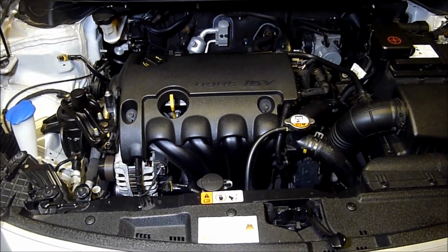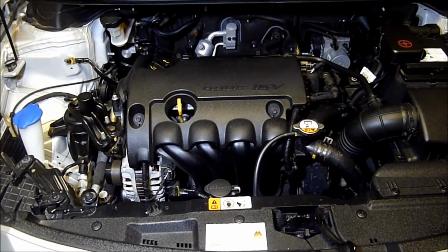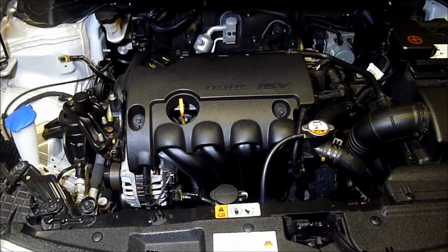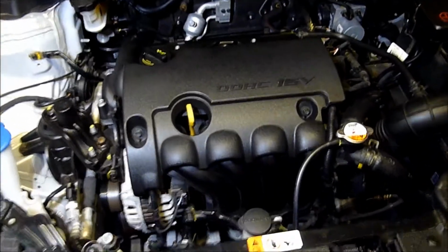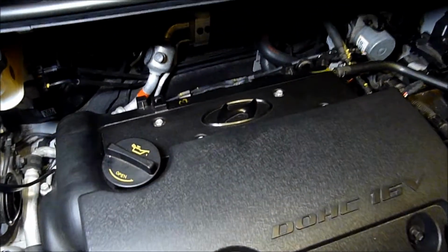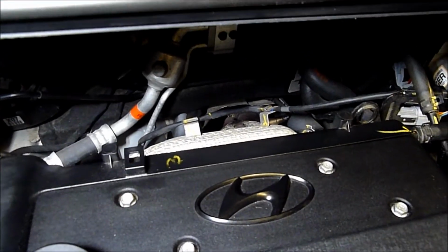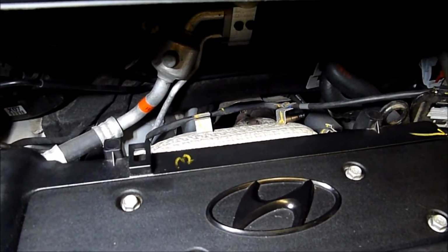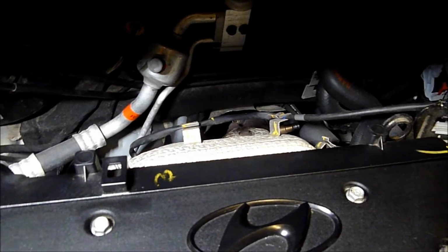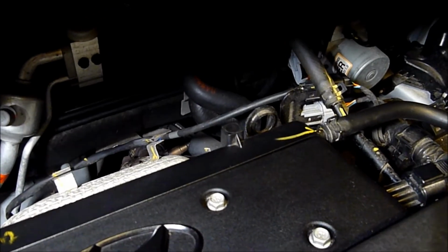They're located at the back of the engine on the manifold, and that's where you'll see the catalyst and the two oxygen sensors. So I'll go in and show you the best I can to their location. As we go towards the back of the engine, you'll see a heat shield there and a cable there in two positions, and then these are the connectors at the side there for the oxygen sensors.